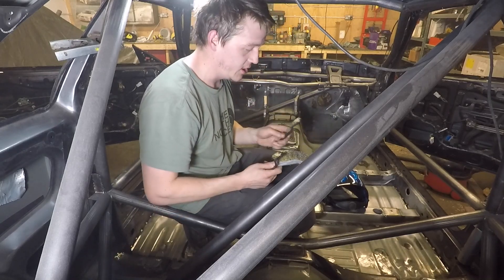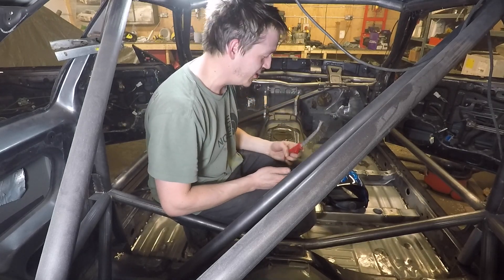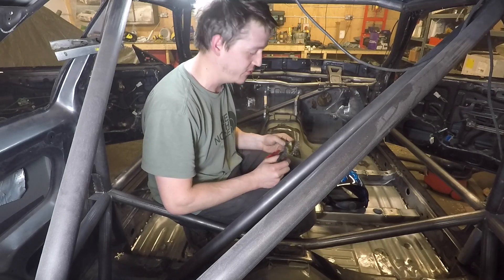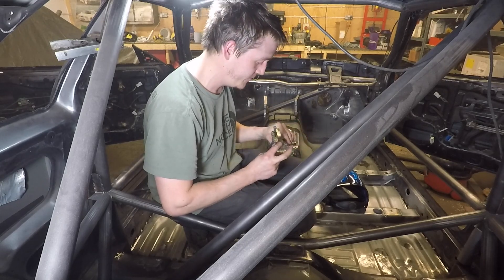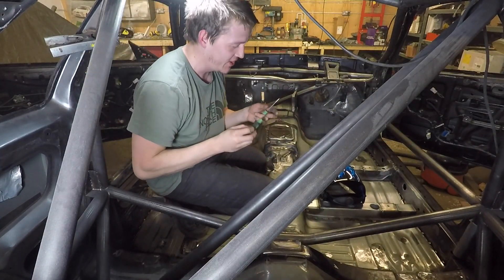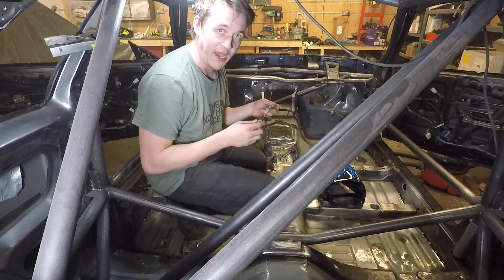There's a little bit down here that needs cleaning up — some wire brushing just in the edge. I've got around here so I'll probably nick one of my mate's hook tools and try and get some more out. I thought it was clean but it wasn't. If it only takes 5 minutes to clean something up, it's worth doing. I think 8 minutes is my cut-off — after that, just try and weld over the top of the dirt. These are the hook tools — Snap-on. They're pretty good. I've only broken one out of 4 but they replace them for free, and they're not mine so my mate replaces them for free.